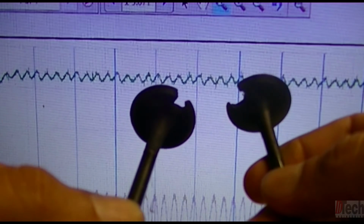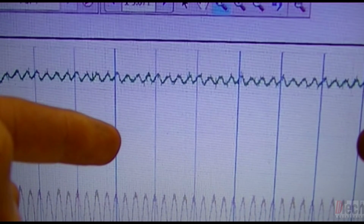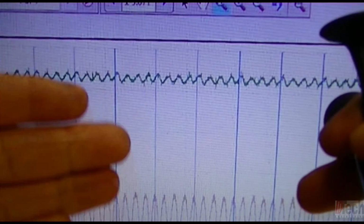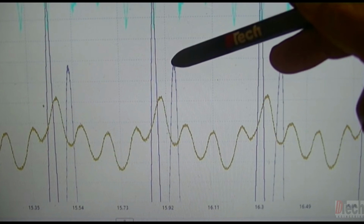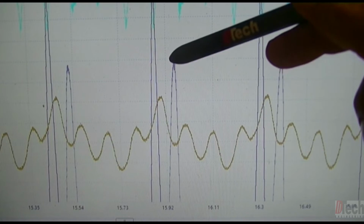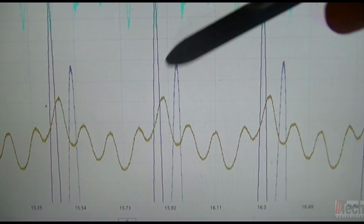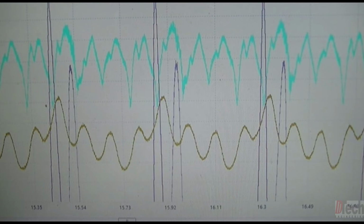Now, I did mention the exhaust trace, and on this one I did not take one or have a picture of it, but I did see a difference there. So we know that this is compression for cylinder 3, the one with the bad exhaust valve. So we've explained this rise, and then on the exhaust trace you can actually see an anomaly there too on this vehicle. Now I hope this comes up on the screen well.